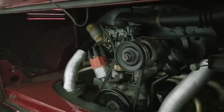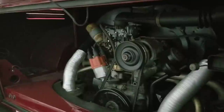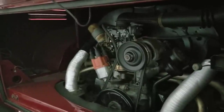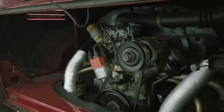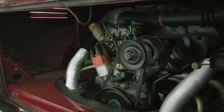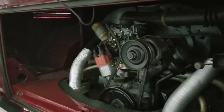The crankshaft: if you're going for bulletproof, go with a forged steel crank. Do not put in the cast one — it's a waste. If you're going to put a cast one in, just go with the stock crank; on a 1600 the stock crank works fine. But if you want it to last longer, go with the counterweighted forged steel. That's kind of where I draw the line.